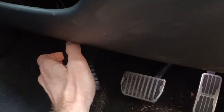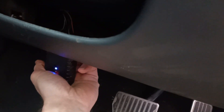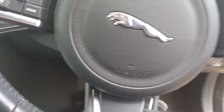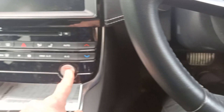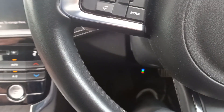The next thing we're going to do is plug the VCI into the car so we can go in and read the fault codes from the TPMS system on the car itself. Using the T2000 WF, we need to have the ignition on the second ignition position so we have all the data lights showing before we diagnose. If we press the start button, you can also see all three lights showing on the VCI on the car interface, which means it's got a connection with the tool.